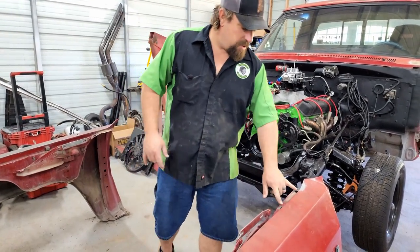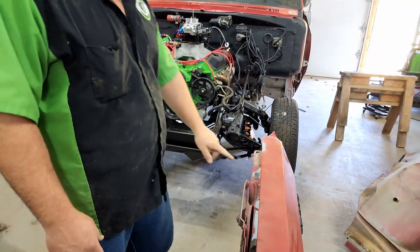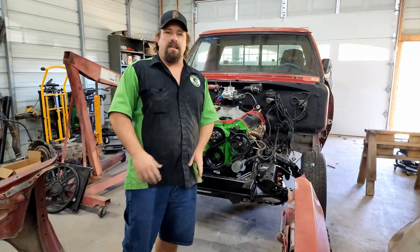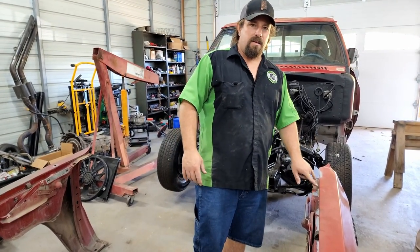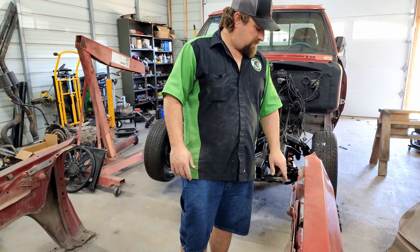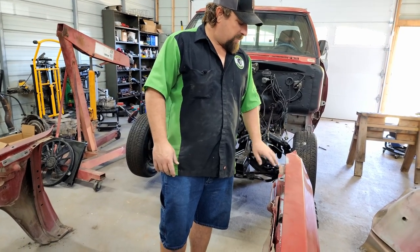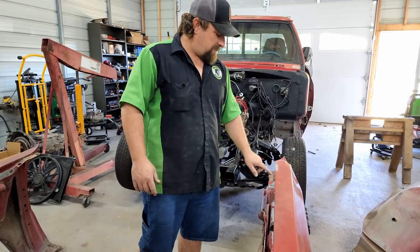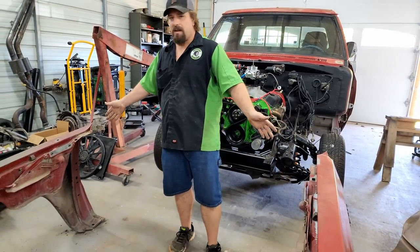The second is there's two bolts on the fenders. One of them is underneath that cowl piece. The other one's not. If this was a use-it-every-day, daily driver street car, probably not a great idea to have one bolt in the top of the fender. But for what we're going to do with it, I think one bolt is more than sufficient. So we can just trim this off so it clears that cowl, and it's got a convenient little rub mark where the cowl was sitting on here. We can just trim that off and one bolt on the top. So that's that taken care of.